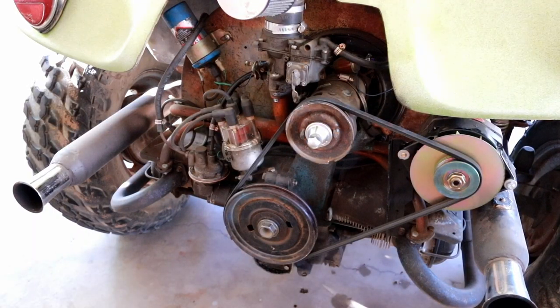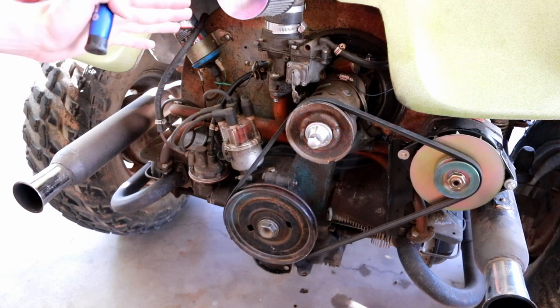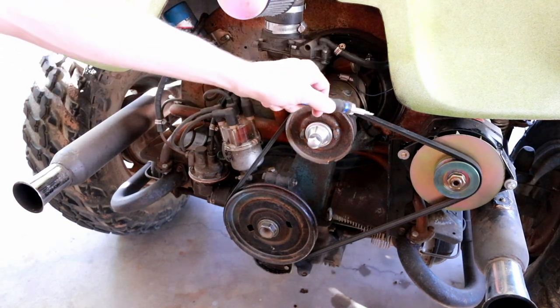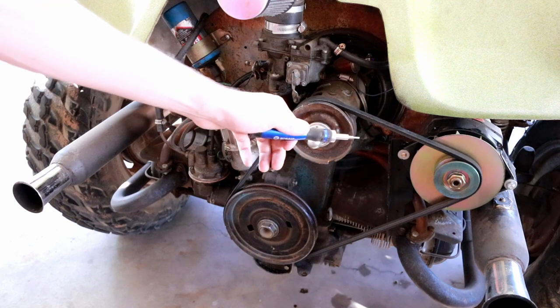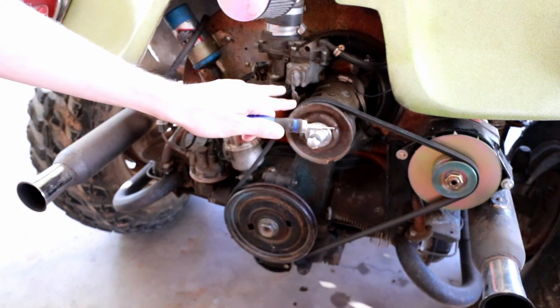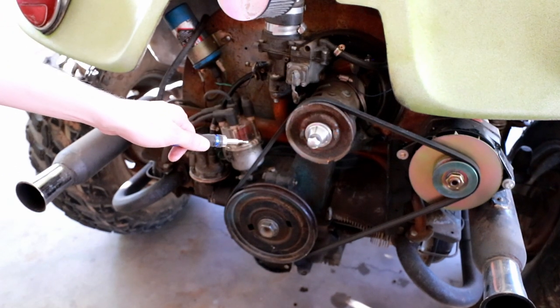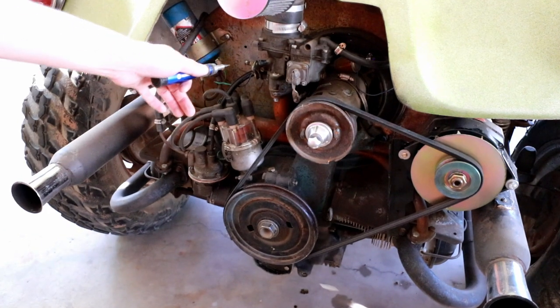Now, before I start up the space heater, I am going to increase the idle setting of the engine substantially, the reason being that this alternator requires a fair bit of speed to get its full current out, and when I first measured the voltage, it was not able to maintain that 13.5 volt minimum to keep the battery charging when the heater was running. So I'll just go right ahead and crank up that idle.